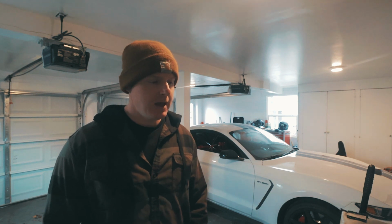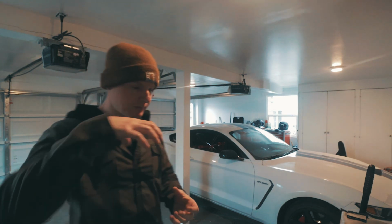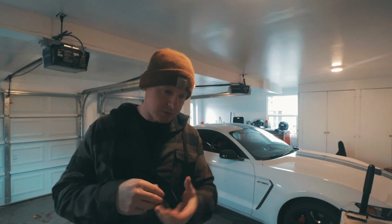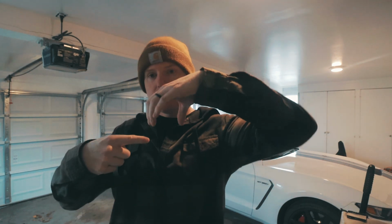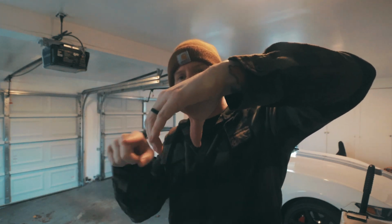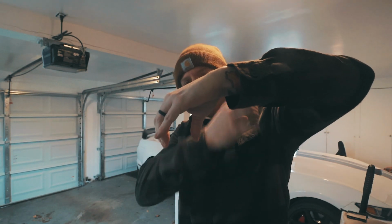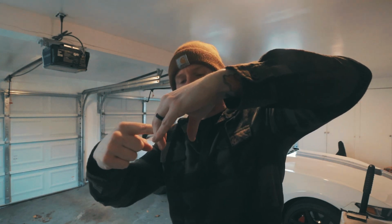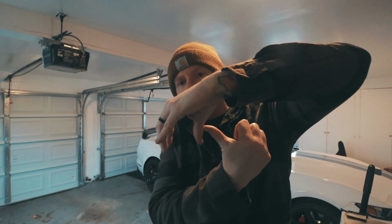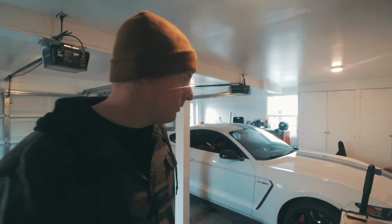I talked to my buddy Curtis, and he said that instead of trying to go from the back of the car, I'll show you guys, he said just to drill through. So maybe start it from the back with maybe a 1/16 drill bit, and then find the hole from the front and go through the hole you drilled, right? There are 2 holes in the front, and then you have a long bolt that goes through them. And this side in the back is hard to get to because you've got the roll bar and everything, and you'd have to climb through the trunk. So if I can get this hole done, and then I can just punch one small starter hole right here, I can drill through that second piece from the front. That's kind of what I'm going for.